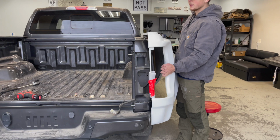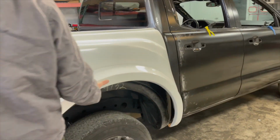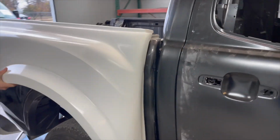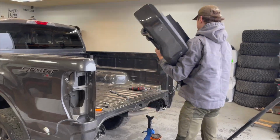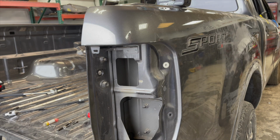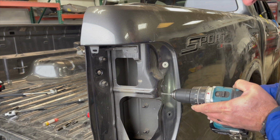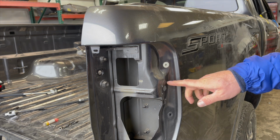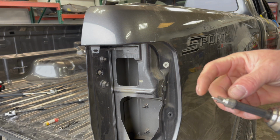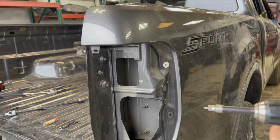Yeah, the bumper needs to come out. Definitely need to take the skin off. So we're about to drill this side panel out. This is how you do it. So first I went and made like a little hole where it's gonna stop this pin not to slide, and then that's the drill bit we're gonna use to cut the weld.